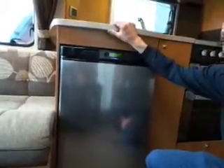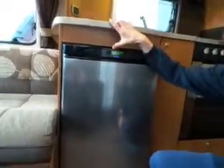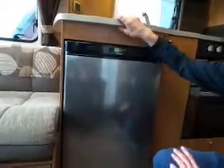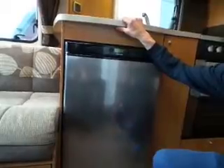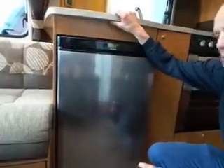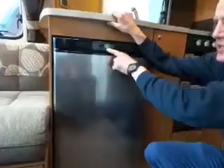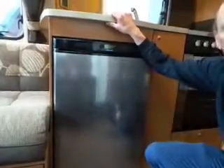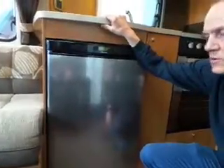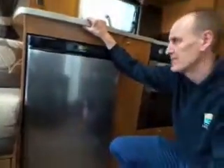When it's coming off the back of the car, the engine's got to be running. You don't need to switch that panel on up there — this is more or less for when you're travelling, to keep the fridge cool, but it won't cool it down. You need to cool the fridge down before you travel. If you've got it stored at home, plug it into electric and cool the fridge around 24 hours before. Just before you travel, switch your fridge on to 12 volt, and when your engine's running it will keep it cool. So you cool it up beforehand, keep it cool while travelling, then flick it back onto electric when you get there.